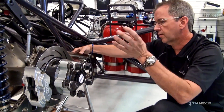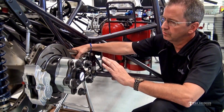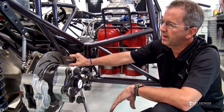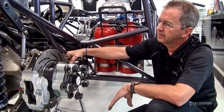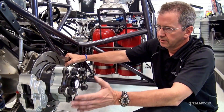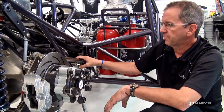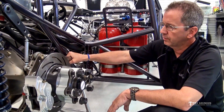We've got the body on, tires and wheels off both sides. We want them off both sides because taking them off just one side still leaves that weight hanging on the other side, giving you a misconception of exactly where neutral is. So we've got the housing hanging on the shocks, it's lined up square, jam nuts broken loose, and we're ready to put preload in.